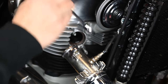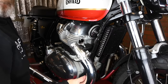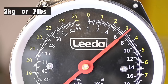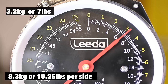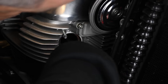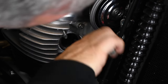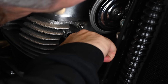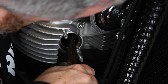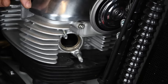The O2 sensor takes a 14mm. This is pretty chunky as well, so I'll put this on the scales. Removing the crush washer is a little bit fiddly — maneuver a screwdriver in there to loosen it up, then use needle nose pliers to get hold of it. It's actually split because it's been smashed in there so hard, but there you go. Make sure the face is nice and clean.